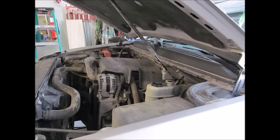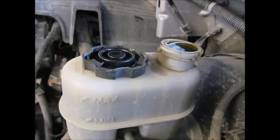Pop the hood open and remove the cap from the master reservoir, because there's a chance that it could explode on you when you collapse the brakes. I've only seen it happen once, but why take the chance if it's that easy to take off? In this case you can see that the owner kept adding brake fluid after the brakes kept wearing down, so I'll talk about how to get that brake fluid out without making a mess.